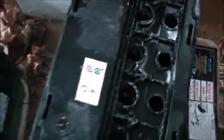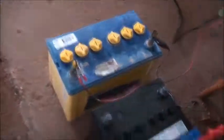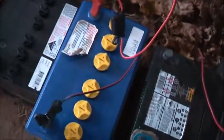So it could be drained flat completely numerous times and recharged. It won't ever be up to that high voltage again — it will drop by about a volt with this new mixture. The reason I want to convert these, and I've read many reviews that it does actually work, is to use this, this, and this in series for 36 volts for my ZVS to charge these capacitors.